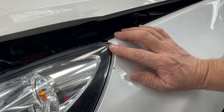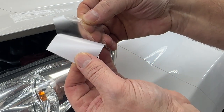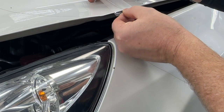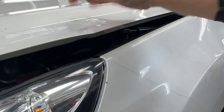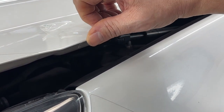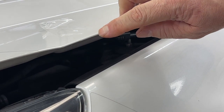If we were installing this, I'll give you a demo so you can see the difference. Here's a little sample of the paint protection film — it's just a clear product. When we put it on, we're going to the edge and sticking it on like this. See how that goes to the edge? And then watch what I'm doing here — I'm going to wrap this, wrapping it slowly so it goes all the way around. Now if a rock hits it there, it's not going to chip.